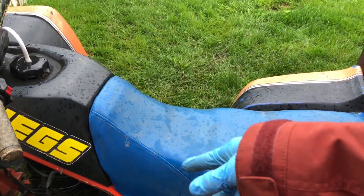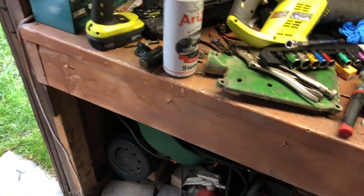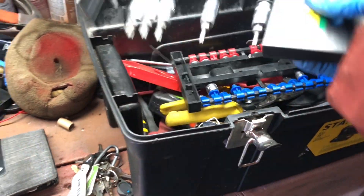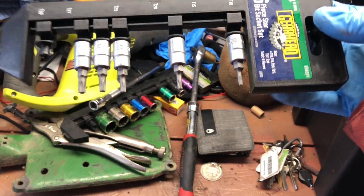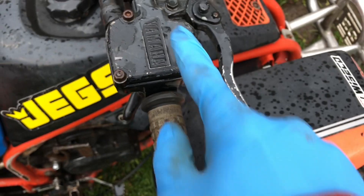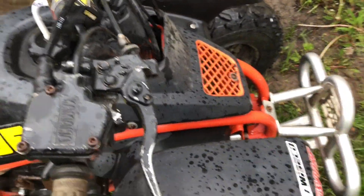To remove it you're going to need some wire cutters or strippers that have cutters on them. A drill is recommended — you could also use a screwdriver — but you're going to need these T bits. I recommend picking these up from Harbor Freight, super cheap. Pick up a set of T10 through T30. You're gonna need this to open up your throttle control compartment here — you could also use Allen wrenches — and pull out the little microchip that's in here and disconnect this linkage.